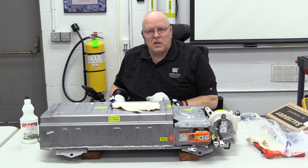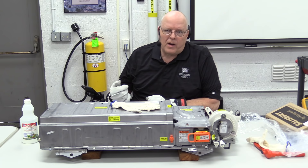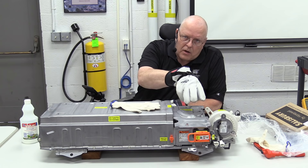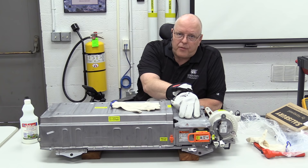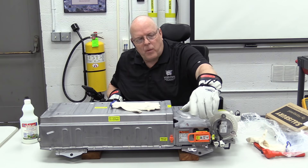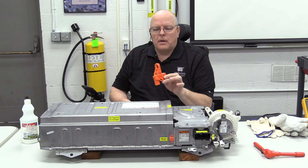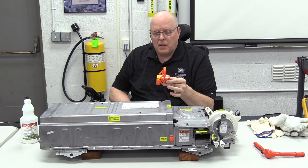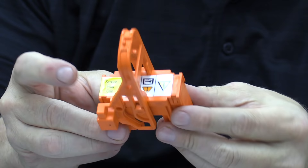To remove this type of service plug grip, we pull it sideways — it clicks — and that disconnects a circuit called the high voltage interlock circuit. There's a little wire harness right there that is the interlock circuit. As soon as you pull it out and open-circuit the interlock, the contactors that open and close the path for current from the high voltage battery instantly go open, if they weren't already open from powering off the vehicle. Then we rock out the service plug grip, angle it out, and pull it straight out. Removing the service plug grip should be one of the very first steps before unbolting anything to get this battery out of the vehicle.